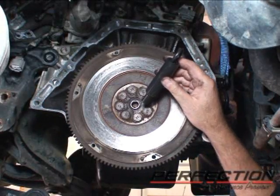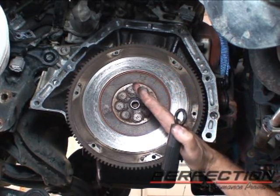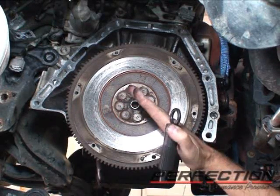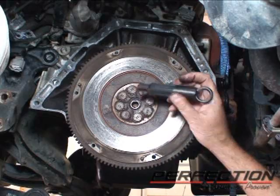Now if we go back to the customer's original complaint, I have a noise that is pronounced when the clutch pedal is up. When the clutch pedal goes down, the noise goes away. Pedal comes up about halfway, the noise starts to appear. About halfway up also is when the clutch disc starts to turn from the engagement process. From there up, we're in the friction zone.